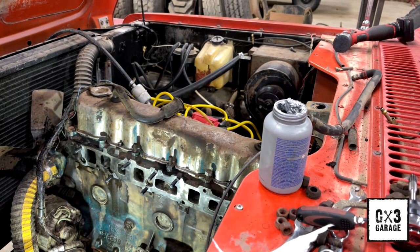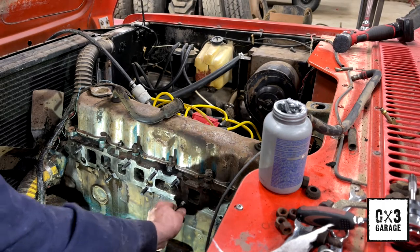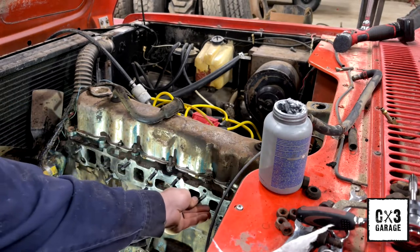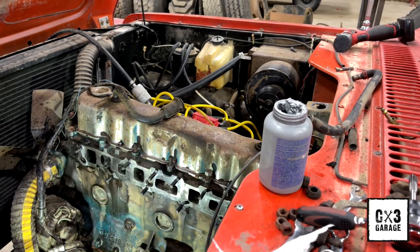You could run them in almost every single one of them by hand, until they started feeling a little resistance in there. Then I just came in with a little ratchet and maybe gave it one more turn, maybe a turn and a half, and then backed them out, made sure I wasn't getting too much material on the tap. Most of what I was pulling out was carbon and grease and dirt. No, not any big metal shavings or anything like that, so that was good. But anyway,